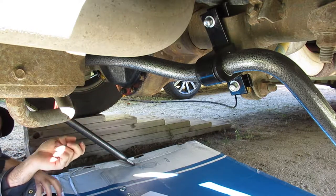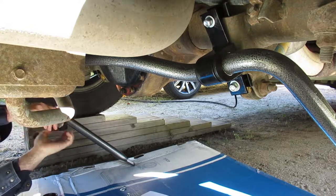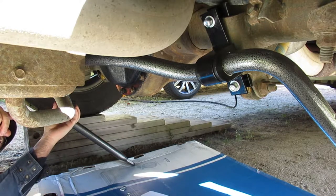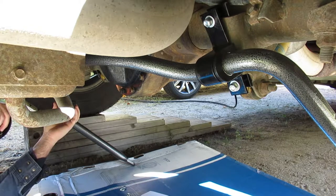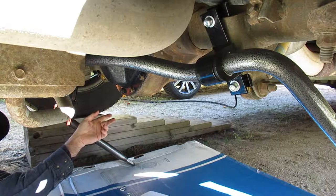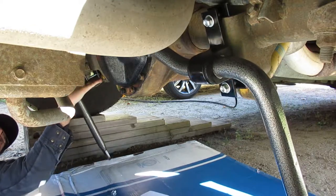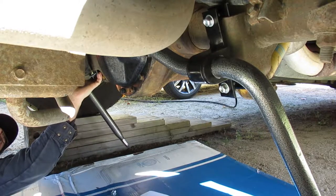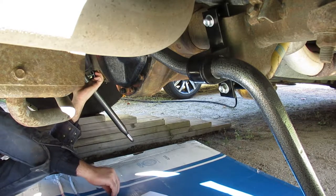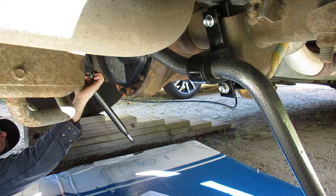This van's got 100,000 miles on it now. I measured the suspension: on the front of the van, the center of the wheel to the fender opening is 19 inches, and on the rear it's 21 inches. I suspect that might play into where we put the end links up against the frame. I'm also hoping to do a 5-inch lift on this van — still doing research to make sure I don't ruin the handling. It needs more clearance; I'm uncomfortable taking it some places because it could get beached, given its 155-inch wheelbase and very low clearance.